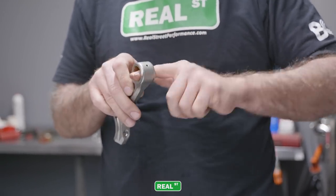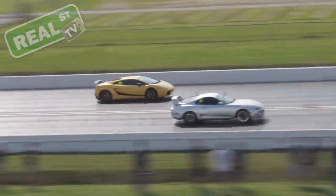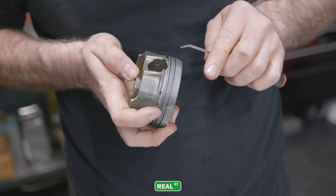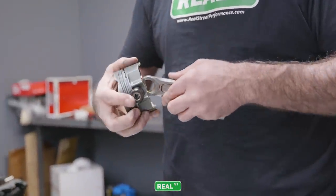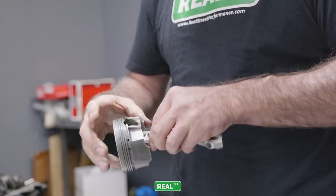I'm using a DLC piston pin. I've been using those since Geo's Silver Supra days. With the high stress level that goes on inside these engines, the DLC coating provides a situation where, when the lubricant is displaced, you don't get the pin galling that you would on a non-DLC coated part. It does add expense, but once the piston pin starts to gall, it's generally a recipe for disaster.